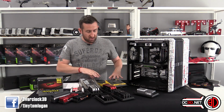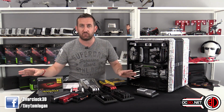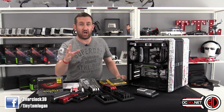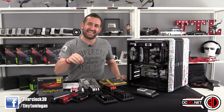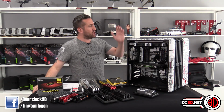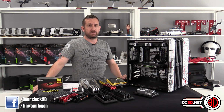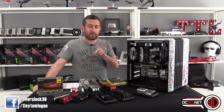I even tried the new LED Vengeance. None of it would work. And when I say work, I don't mean XMP. It wouldn't even let it post. Now you're thinking to yourself, for God's sake, Tom, you could have just said it doesn't work with most 3200 megahertz memory. And you're right, but there's a slight problem with this.